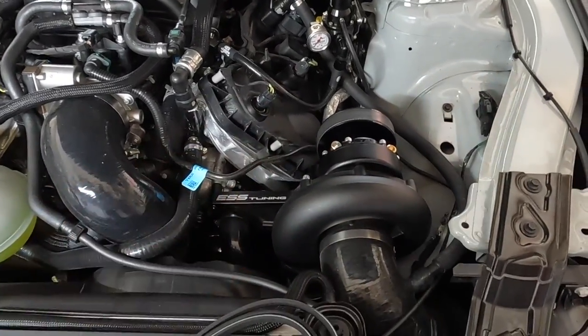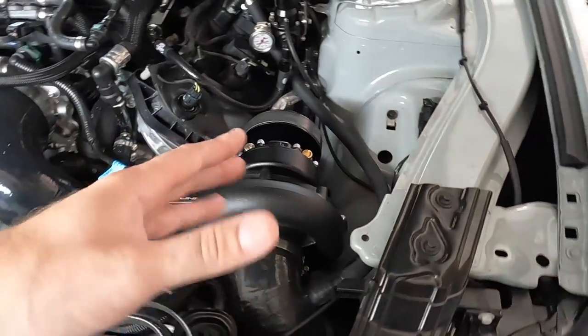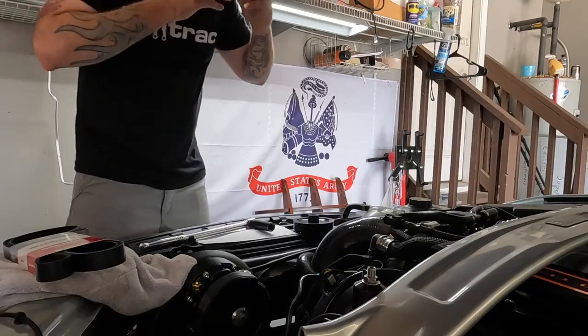That's typically another 70 to 100 horsepower - honestly around 80 to 100 - so we should be all over 830 to 840 horsepower. We still have stock headers on the car so we're going to run into cat over-temp protection pretty quickly. I need to get headers on this car ASAP, and a clutch. But everything about this supercharger including the belt routing seems to go on and fit a little easier than some of the competition. Let's install the smaller pulley on our boosted Mach 1, turn it up a little more, and do some data logging wide-open-throttle hits today.